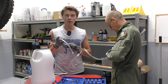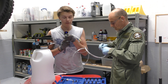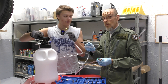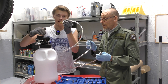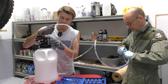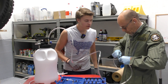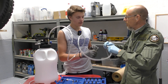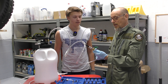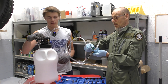We're filling our diff here. The adapters would screw in, but we've got the sway bar in the way and there's no adapter that goes in at right angles, so we're just going to use a filler pipe. We've opted for the clear pipe because you can see the oil flowing through it, which is satisfying. It clips in, and there's a valve on the end to turn it on and off.